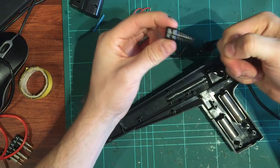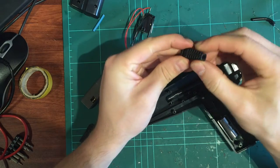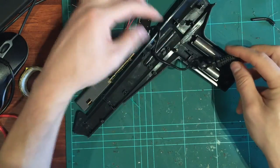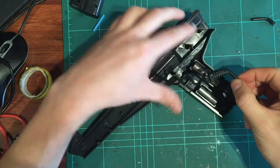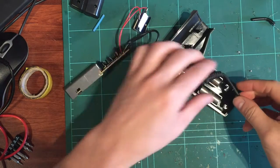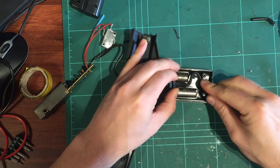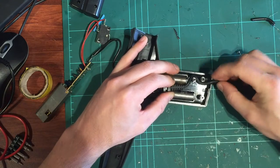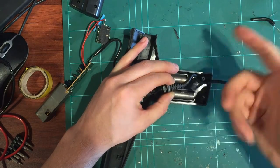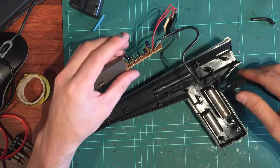It was really hard to slide the cable through this. I was hoping I could just slide some more cable through it, snip the cable and resolder the points, but it didn't really want to slide too well. So I just turfed it and basically shortened the wire, cut it off before the break, fed it all the way through, and resoldered it to these points up here on the other gun. When you're finished and you want to replace this stopper, make sure the cable goes around the posts just like that. When someone pulls it this direction, it adds tension to the wire physically with friction, and it's going to protect the cable and the joints. So that's what I ended up doing with the other gun.